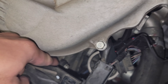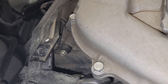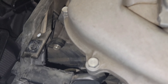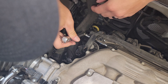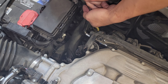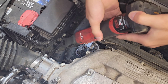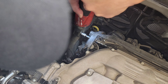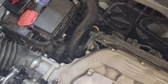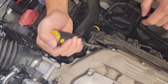From the top of the engine, this is the PCV location, and that is a 10 millimeter bolt. We'll be removing that. I'm using a 10 millimeter socket with an extension — short socket — just to break that off. Pull out the bolt, then using a long Phillips we're going to try to pry this thing out.